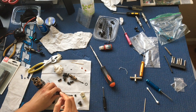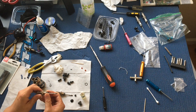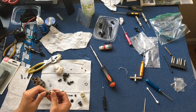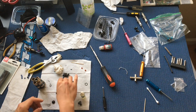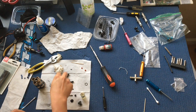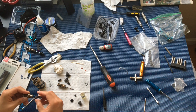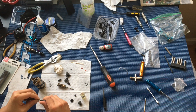You'll also want to clean out any gunk on the inside of the shock after you've dumped the shock fluid out. Just make sure that retainer — the bottom part of the shock body that threads in — is finger tight. You don't want to crank it down. We're also putting in a rubber bump stop so that the shock doesn't bottom out onto the shock rod.